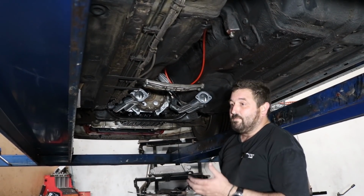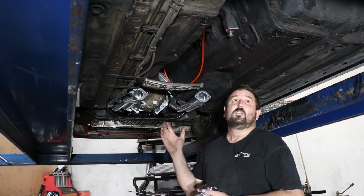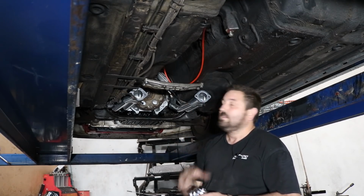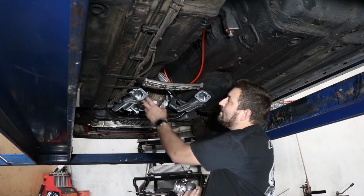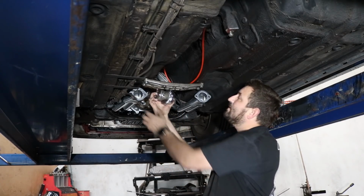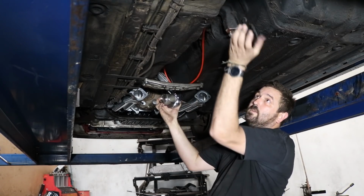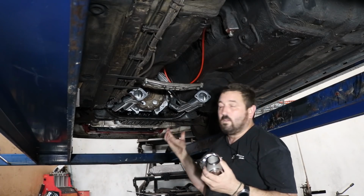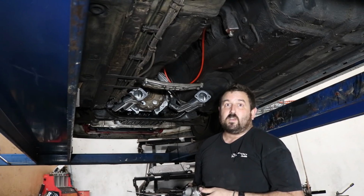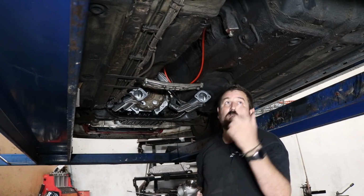But in my mind, I want to try and get some exhaust volume back when it starts making some power. So I can't see why we can't put the wastegates at the front, put the turbo at the back. So we'll come out of here at 2.5-inch, turn, get into some gates, and then continue on as twin twos, and then merge these two into a common hot dog in the middle. So when the thing's online and it's on boost, we should get some flow back through the wastegates. And keeping it two and separate, it'll maintain the split pulse all the way to the scroll.